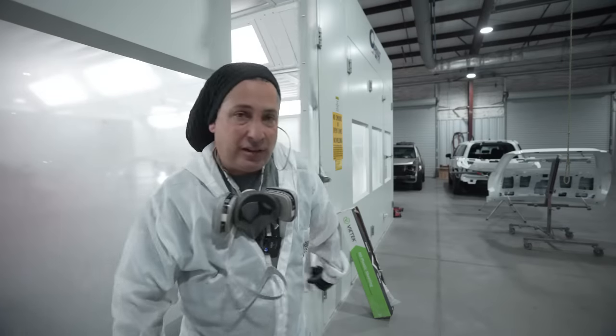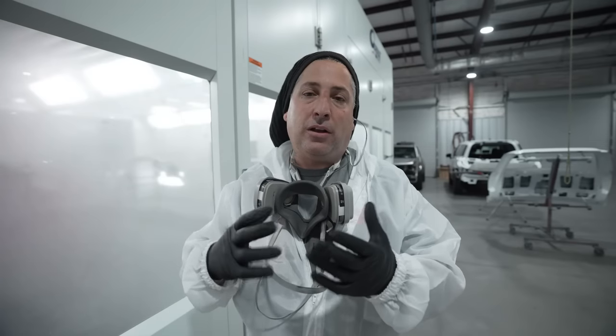All right, so it's as easy as that. You apply the one heavy coat for coverage, and then you back up and you give it a nice medium coat over the top to lay out the metallics. You guys see that we're using our old 3M gun. That gun lays it out beautifully. You have a lot of control with that gun because it's confined to one area, whereas some of the other guns like to atomize it a lot and have a bigger pattern.